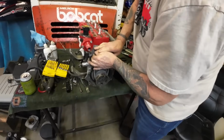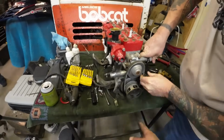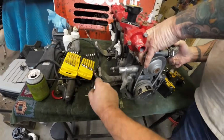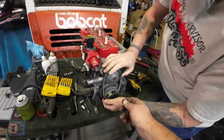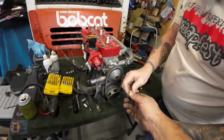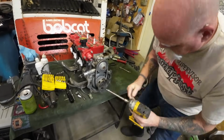Now here's the other thing, Lonnie. Yeah, that hose is pretty stiff. Well, the other thing we can do is we could take these pulleys off down here. Or we could just take this hose loose. I'm fighting against this hose. Well, if we take the pulleys off down here, it'll just come off, and I brought you a 10 millimeter, so they'll come right off. Yeah, we gotta pull these off anyway. Yep, it's loose now. Yeah, we're just getting a bunch of slack.